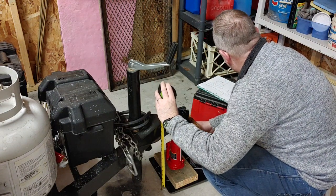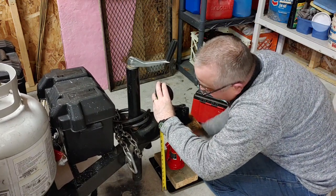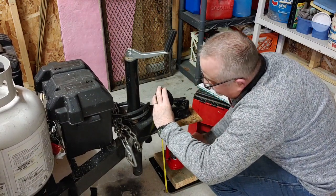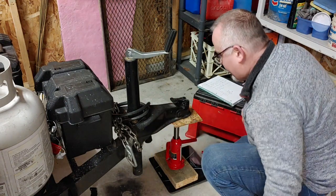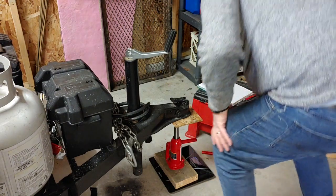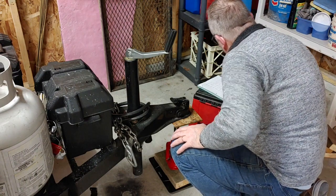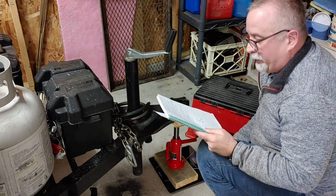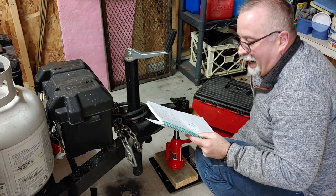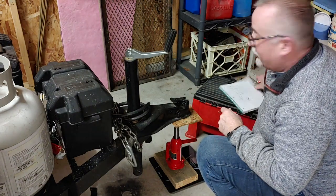The number at 14 and a half inches is 251 to 252 pounds. So at the first four positions: level is 243 pounds, down two inches is 252, down four inches is 254, and down six inches is 261 pounds — just by lowering the height. Now we're going to reset this and go up.